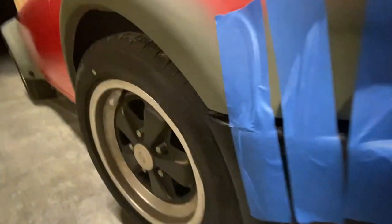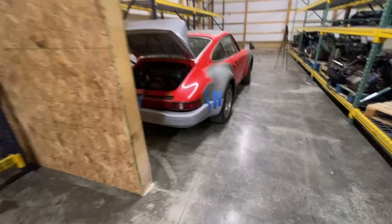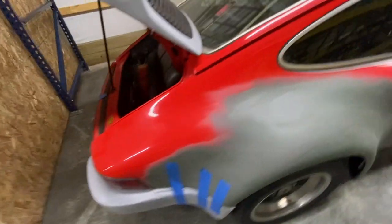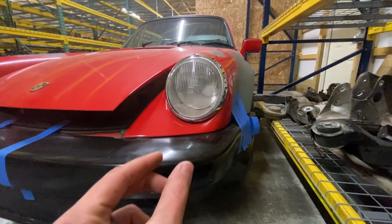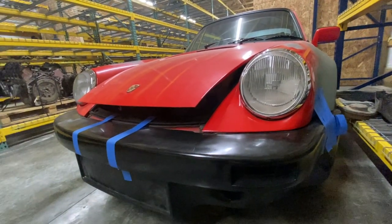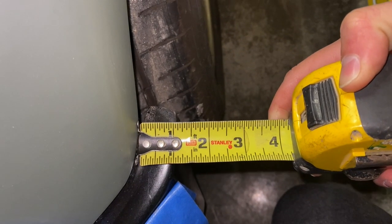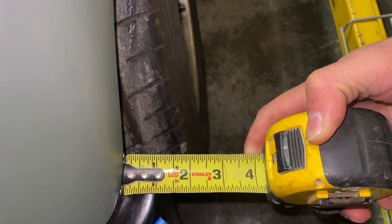On this side, it's basically flush - that's perfect. But on the other side, it's about an inch, inch and a half too wide. There's no flex in this bumper - it's pretty solid. The rear bumper has some flex so you can move it a little bit for adjustment, so the rear is fine, but the front definitely needs some love. Measuring across, the other side's flush and this side's about an inch too wide. Basically going to have to take off half an inch on each side - I might do like an inch and an eighth, but I don't want to do too much.